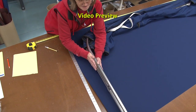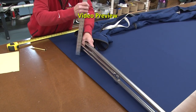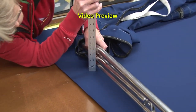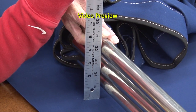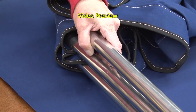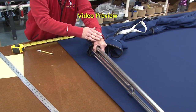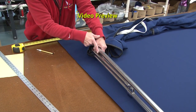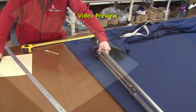You want the highest height of your frame bows. We're a little bit above 4 and a half, so we're going to say 5 inches. Let's write this down as well. Then you want to add 2 inches to that for each bow you have — if you have a 2-bow that's 4 inches, if it's 3-bow it's 6 inches. So at 5 inches plus 6 inches, that will be 11 inches.